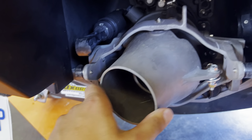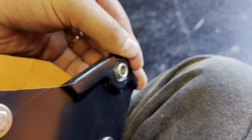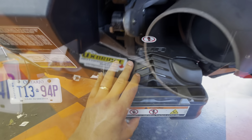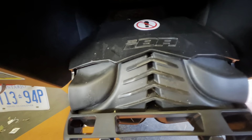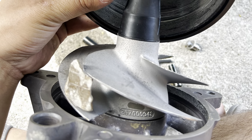That's pretty well tightened, and now all that's left is the IBR. The piece I said don't lose — those bushings — just skated across the floor. Be very careful with those. I usually put a bit of Loctite on them. This linkage has a little bushing in it, and it helps to make sure the steering is straight when you put it on — so straighten out the steering wheel first.